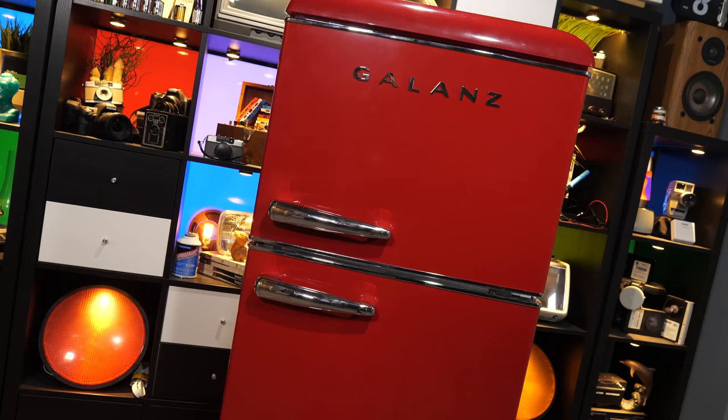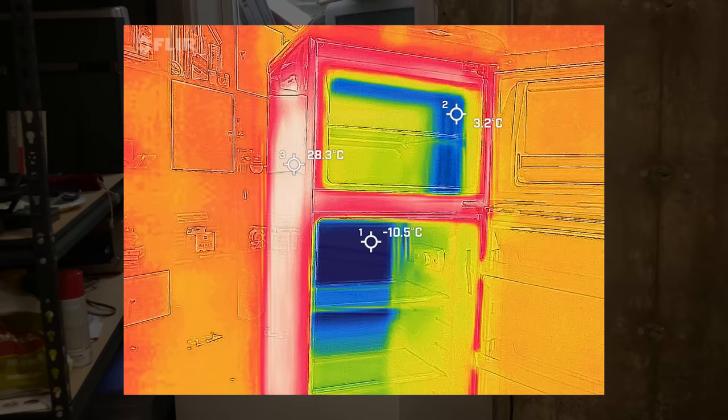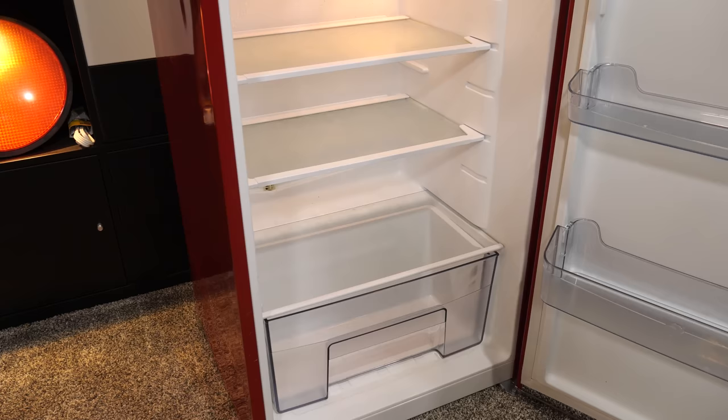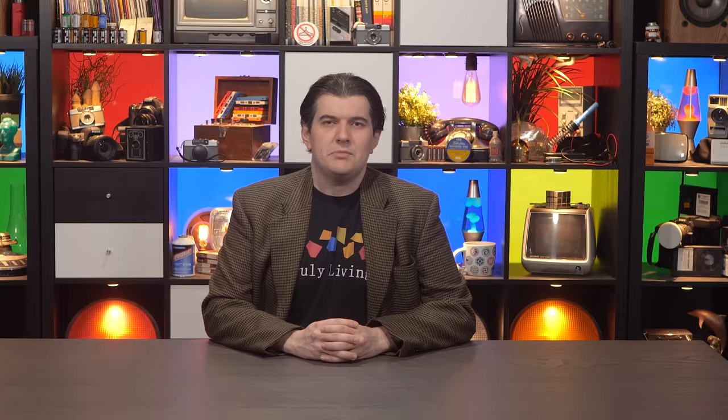Now, I should note that it's not like this is a totally unique fridge. Plenty of mini-fridges with separate fridge and freezer doors appear to use this split evaporator design, but this is the first time I've encountered it, and I love it. Chest freezers have a reputation of lasting forever, and I think this is largely from the fact that they're so darn simple and there's hardly anything to break. Assuming this fella was put together correctly — which, judging by some of the corrosion around these braze joints I'm not super convinced is the case — but assuming they hold up and it doesn't leak, this could just keep going for decades to come.